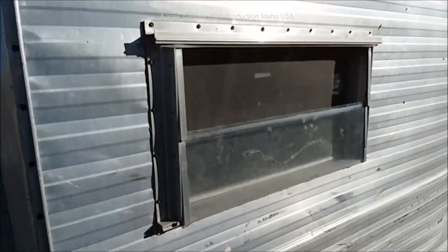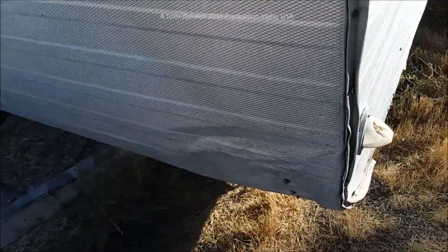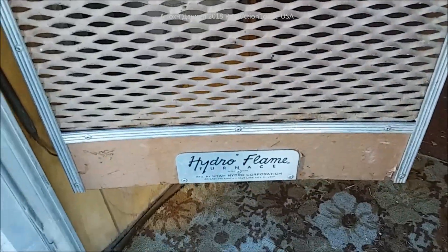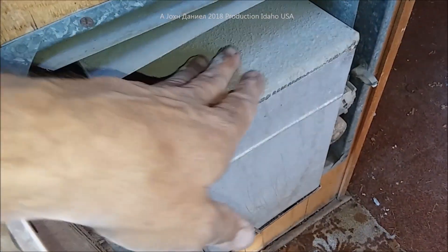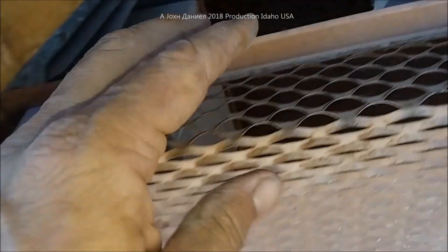So what I'm working with is whether or not I should restore this thing — it's pretty bad, has a lot of age on it. Flatbed or a really expensive restore job. Looks like it has a real nice looking Hydro Flame heater in it. There is the sensor bulb right over here because it is a standard mechanical thermostat system. Normally these would be all rusted out — just dirt. These cans would be for the heater out here. And it's not rusted out. So possibly this heater will be salvageable — a 1959 model heater.